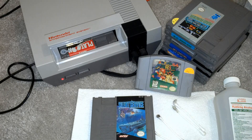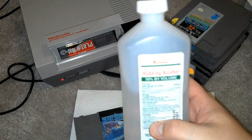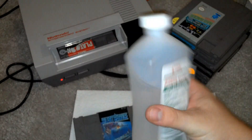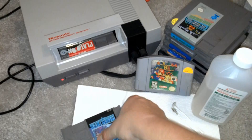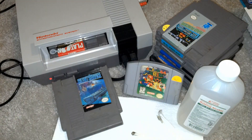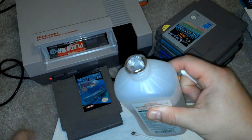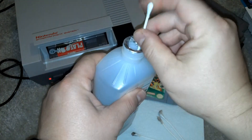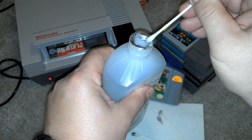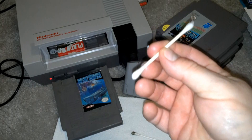Anyway, with Platoon in the background, let me explain this. What you're going to use — even though the Nintendo cartridges tell you never to use it — is rubbing alcohol. You can get this for like a buck, so it's totally cheap. You take your cartridge, get a Q-tip, and drench the Q-tip in there — all the way around. Get some of the excess liquid off, kind of pushing it off like you're painting. So now this thing's pretty moist on one side, and the other side's dry.